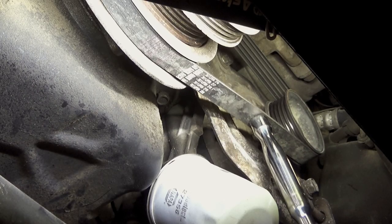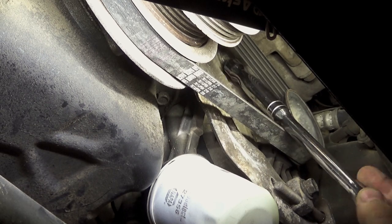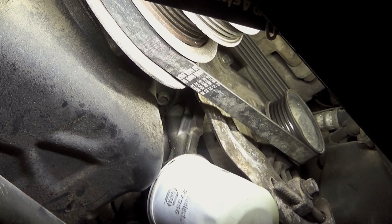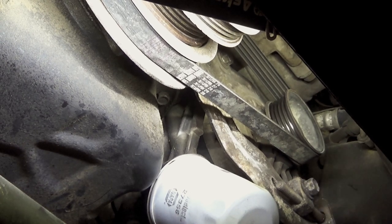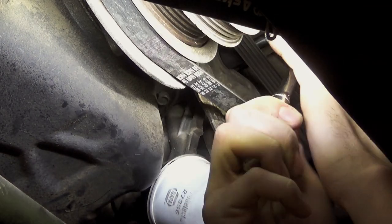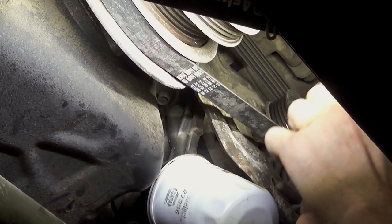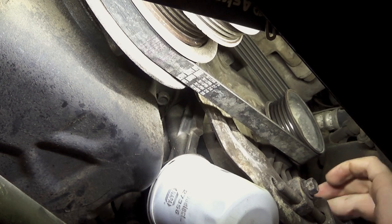The alternator belt is a little bit loose. It has a fastener here and then you can barely see one up there, so I'm going to loosen up this bottom one just because you can actually see it fairly easily. This is not the fastener for the jack screw — that's actually on this side. Let's grab this top one while we're at it. We don't need to loosen it too terribly much; we should simply be able to rotate this.